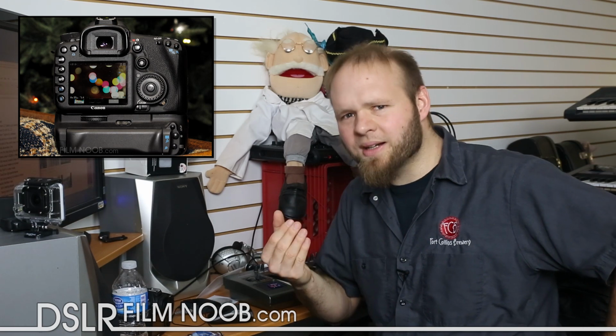I have had 1 or 2 times where my T2i locked up and I had to pull and remove the battery, but I almost think that's because of the memory card class that I was using, because it happened during recording. Some of the cheaper memory cards can cause you problems with Magic Lantern if you're trying to use those while you are recording higher bit rates. So keep an eye on that. That could be the source of your issue.